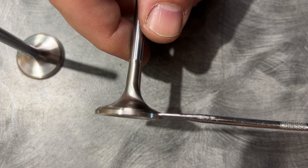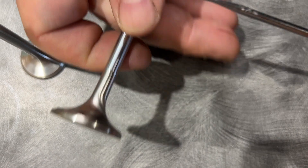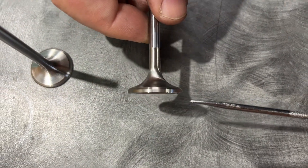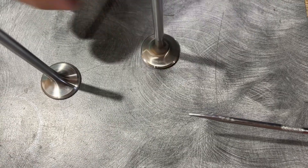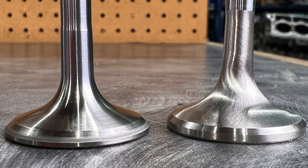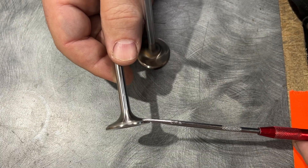It's going to sit farther away from your lash and your spring will get tighter — unless the manufacturer makes up for it on the other side of the valve. Now just because you bought this valve and it's for a 2JZ, this is the same manufacturer, and you can see here the margin is much different — it's much thinner. So how is this going to affect stem height? Let's show you.